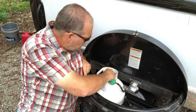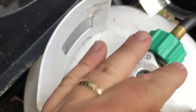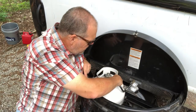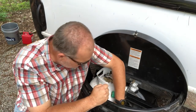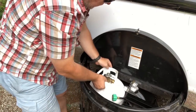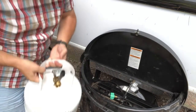First, I'm going to turn the valve clockwise to the closed position. Closed means the tank is shut off and no propane is leaving the tank. Then I'm going to turn and release the hose coming from the trailer — and now that's completely off. Finally, I'm going to undo the screw to release the band that holds this tank in place during travel. You just need to unscrew it loose enough that you can grab the tank and gently pull it up and out.